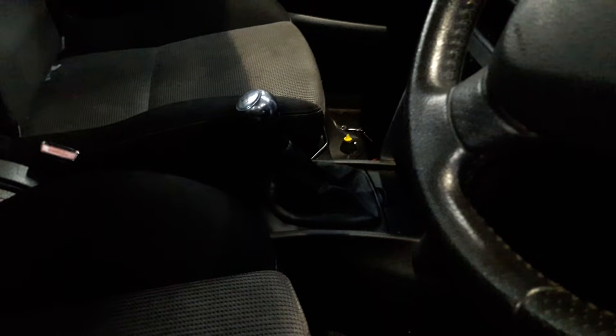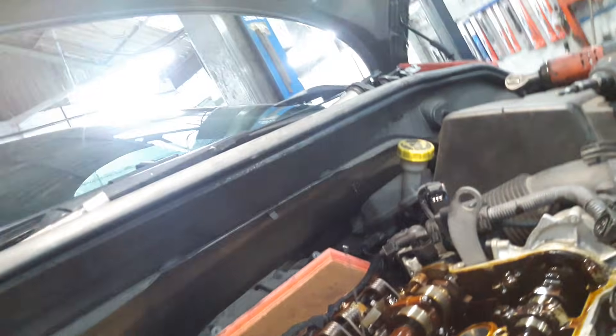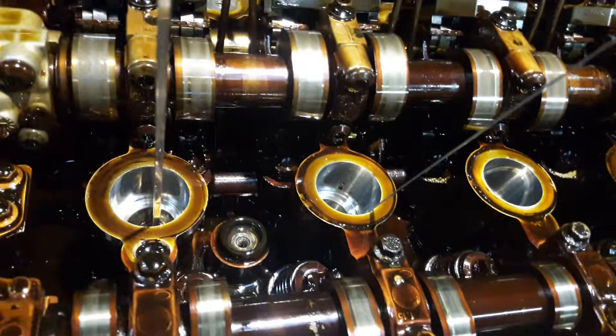I've put the car in fourth gear and lowered the nearside down onto some chocks. The timing is not yet set at TDC — the pistons are level — so with it being in fourth gear I'm just going to turn the wheel to rotate the engine. They're near enough dead level now, which gives me an approximation on where to lock the pin on the flywheel. I could be 180 degrees out but we'll check underneath and find out.